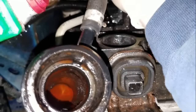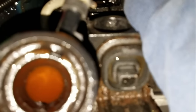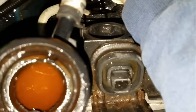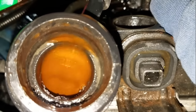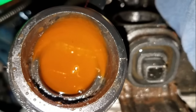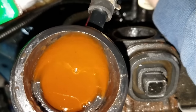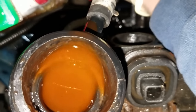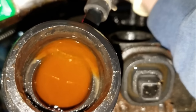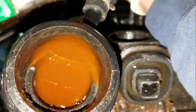I'm not feeling any pressure in the hoses, so we're going to move on to our next head gasket test. I'm going to start the motor — you want to do this on a cold motor. It can be done on a hot motor but you don't ever want to open the radiator cap when the engine is hot because you could burn yourself. So on a cold motor, I'm just going to watch for bubbles. As you can see, we have bubbles coming out of the top of the radiator. That's an indication that we have combustion gas escaping past the head gasket and we could potentially have a head gasket issue here.